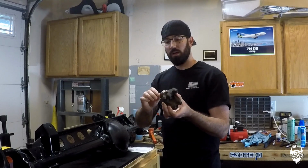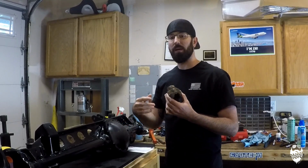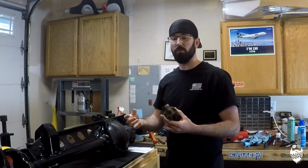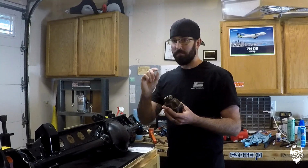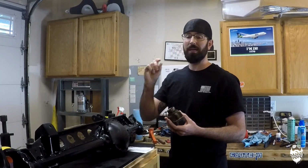And I have to say that we wheeled the whole time at King of the Hammers and we had no problems with the pinion nut or the Ford 9-inch. So it actually worked. Make sure if you're doing the big bearing that you go ahead before you start and order that pinion nut.